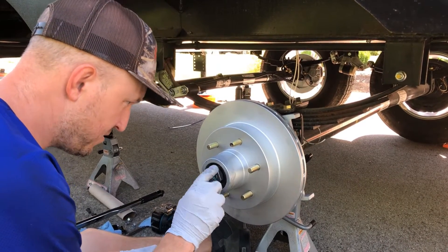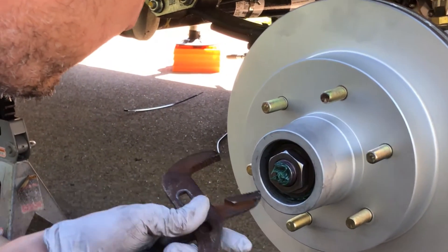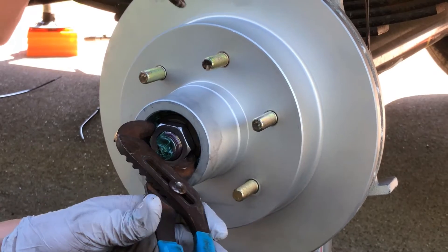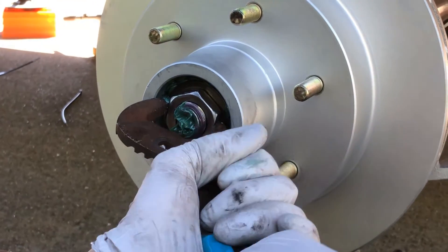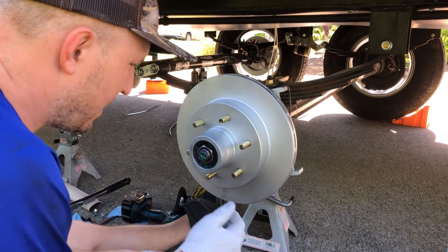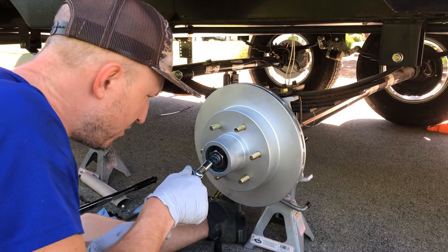Pumping now — it's starting to push the bearing forward and you can see a little coming through. I'm going to give it a little rotation since there's only a filler on one side, to ensure even pressure. I'll put the nut on so I'm not pushing the bearing out during the final fill. Hand-start the washer and nut, then take an adjustable wrench and tighten it. The idea is to get it tight initially to seat the bearings — you can see grease pushing through. Then back it off just a quarter turn to where you can still spin it by hand but it's not actually loose.